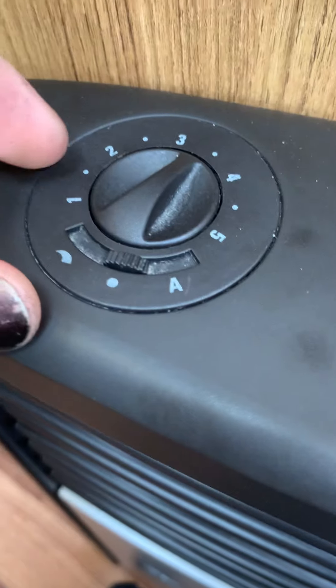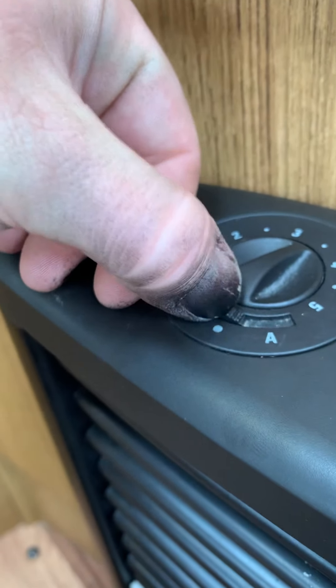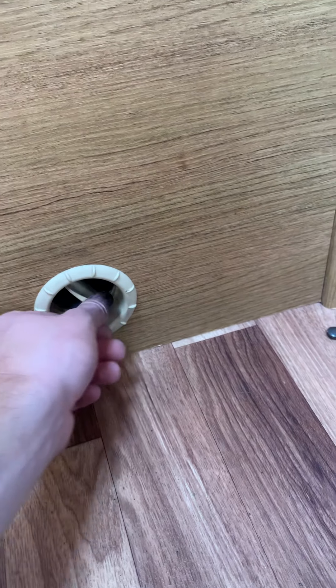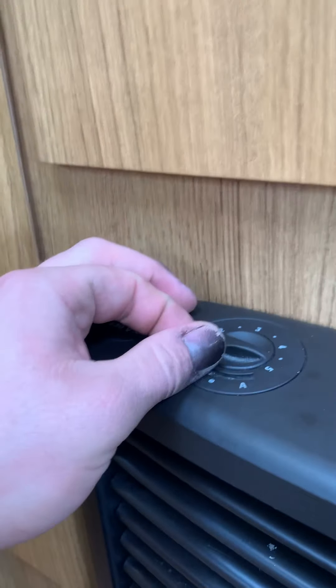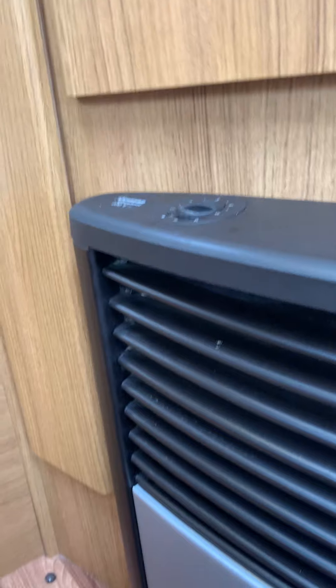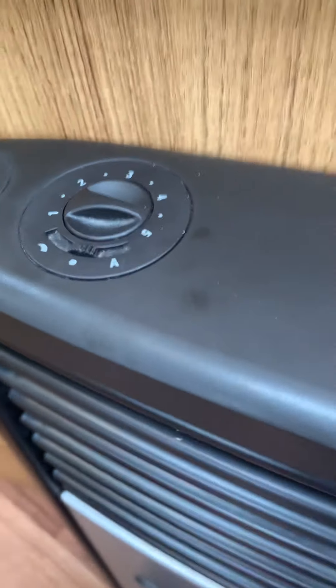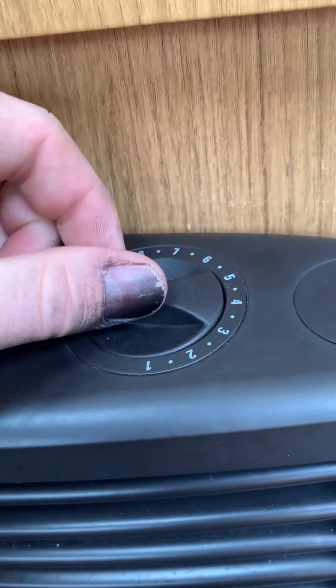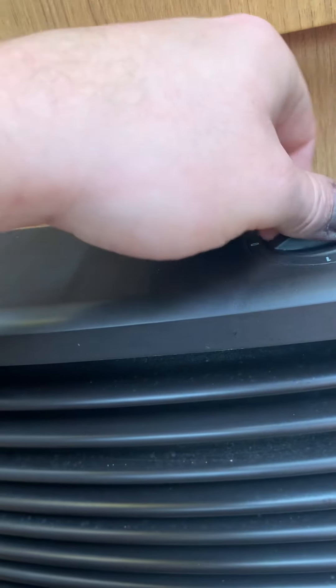On the left hand side here you've got your fan — all these little vents around the van will have air coming through. If you pull this to the left and then turn it all the way up, you can feel a nice strong amount of air being pumped through there. Switch it back to the middle for off. You can also put it to the right for automatic, but I think it's much easier just to turn it to the left and choose your speed. On the right hand side we've got the actual burner itself. If I just turn it around to one or two to start with, you'll start to hear the igniter, and you should be able to see it in here somewhere.